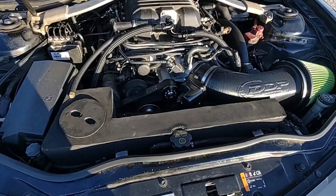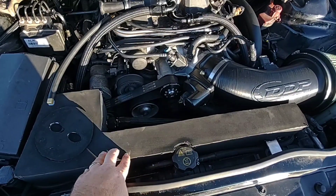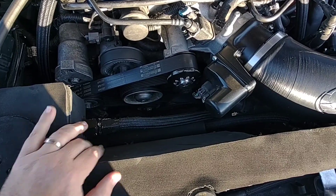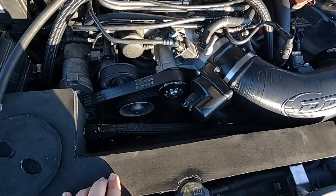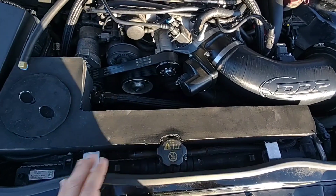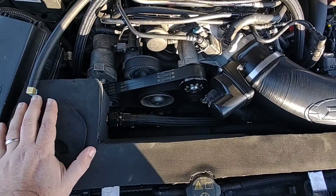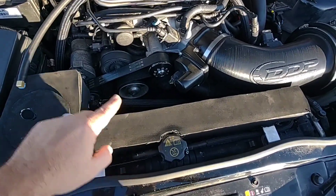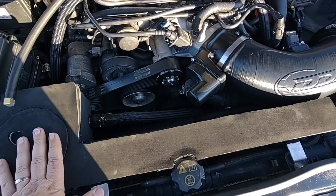Here's our final system. We have the chiller in the bumper. We've got a two gallon tank from Black Market Racing which I have insulated and sealed as you can see. The water is pumped from the tank to the factory ZL1 pump, up to the blower lid, out of the lid, through the chiller, back up to the tank. I actually have it hooked up backward intentionally because this tank has a port here and a port here. Since I do mostly straight line racing, the fluid can slosh during inertia, so I put the output right there to the pump so it would never be starved for water. I put the input over here. From the manufacturer it's designed to work the other way because there's a filter that keeps chunks of ice out of your system, but I'm not using ice — I'm using 50-50 — so that's not a concern. I just don't want to get any air in the system.